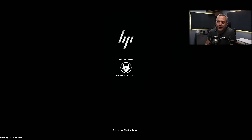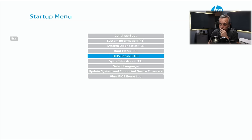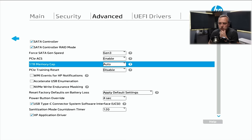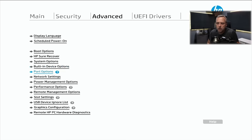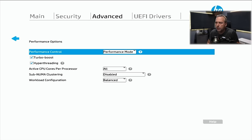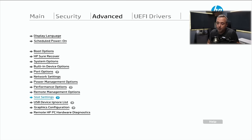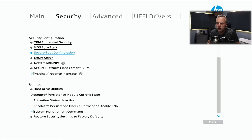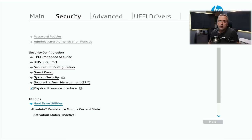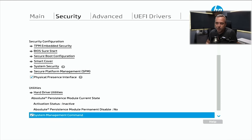The one downside to this monster workstation is that boot times are not fantastic — sometimes they take upwards of a minute. There's our startup menu. BIOS setup should be under advanced usually. Let's go System Options: RAID mode, Port options, Network settings, Power management — nothing there for IOMMU. Performance, Remote Management — ME is off. Slot configuration, Graphics configuration — none of those seem relevant. HP Cloud Managed — let's just disable that, we don't need it. I don't see any IOMMU options here. Let me enable Fast Boot and set the startup delay to 5 seconds. I think IOMMU is probably enabled by default on this system since people get it mainly for virtualization.